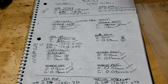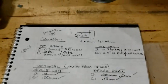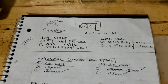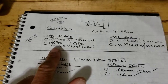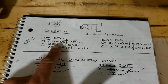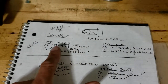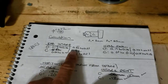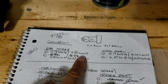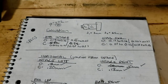First things first, you'll want to create a table for all the measurements you will be taking, and you'll also want to write down the Ducati specs for the clearances. Ducati's kind of strange — they have the specs it should be within, and then there's also the measuring specs. The actual specs, like 0.13 to 0.18 for the openers on both intake and exhaust, is what they ideally should be between, but if you measure it to be between 0.10 to 0.25, that is acceptable and you do not need to change the shim.